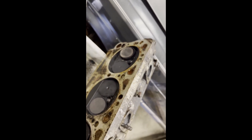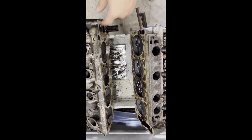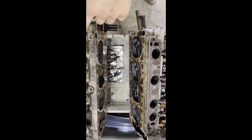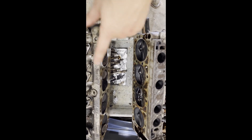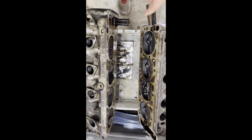What I would like to know is: did these valve seats drop down first on both cylinder heads? Or did something else happen — did the rocker pop off and make this happen? I think the rocker popped off because of this. I'm not entirely sure, but yeah, we can work with it.